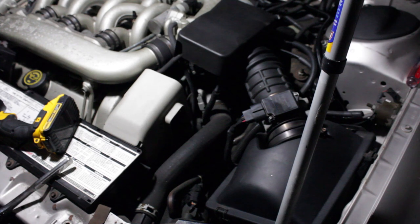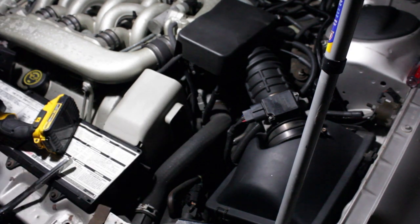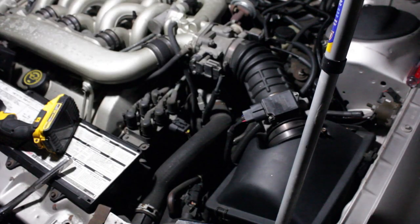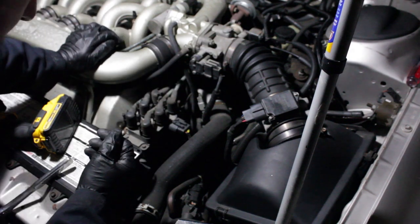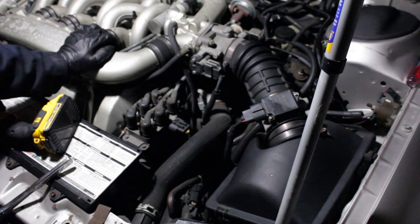The first thing I want to troubleshoot is the coolant temperature sensor — the one that goes to the actual gauge in the car. It's pegged at cold all the time, doesn't move, so there is a sensor issue. To get to the sensor it's a little challenging on this car. These covers kind of just pop off — there are a couple little spots here, and then this one has a screw. The one over the throttle body just has a single screw, so that's pretty easy to remove. Get those out of the way — it's obvious they were trying to church up the engine bay with some little plastic covers here and there. The sensor itself is down in here and it is pretty challenging to get to, so I'm trying to remove as much as I can.